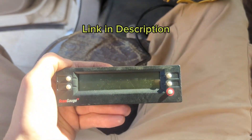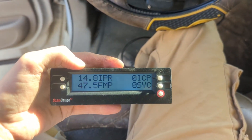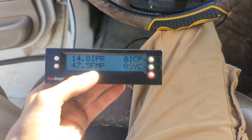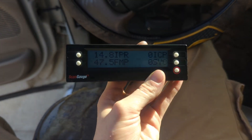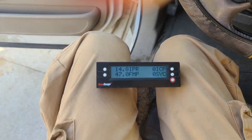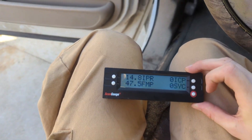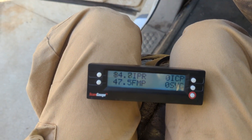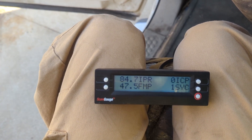If you don't have one of these scan gauges, that's fine — you just need something that will read the values I'm about to talk about. I'll have a link in the description if you want one. One of the easy checks we can do is FICM voltage. FICM sync is going to be zero until you turn the key forward — then it should turn to one. When the key is forward and the engine is not cranking, it's going to be zero. Let's watch when we crank it.